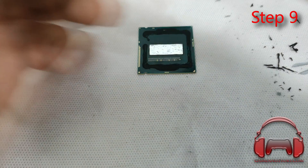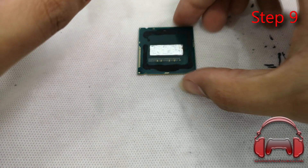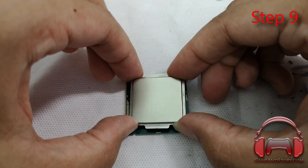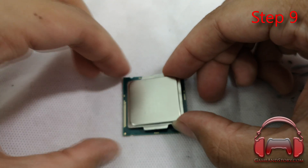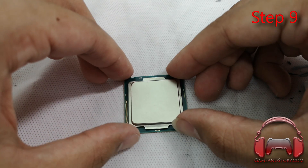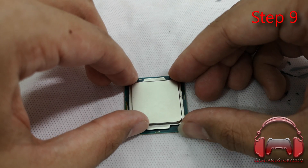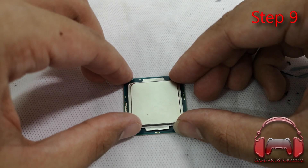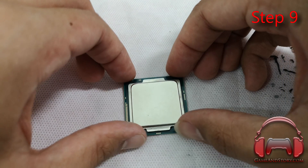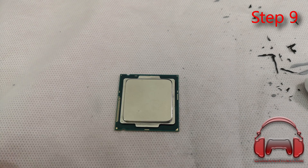Step nine — final assembly, or second-to-last step. Put the heat spreader back on top of the CPU die. Don't forget to line up the two dots for the upper notches on the CPU correctly, then gently let it down so it lands square. You can adjust it slightly, but try not to adjust too much — you don't want the Conductonaut running around on the inside. There you go, your CPU has been reassembled.